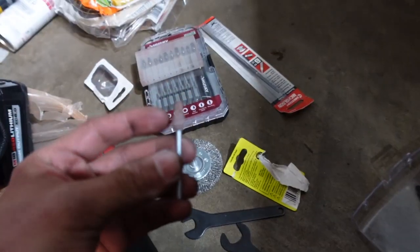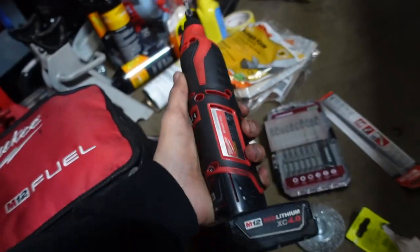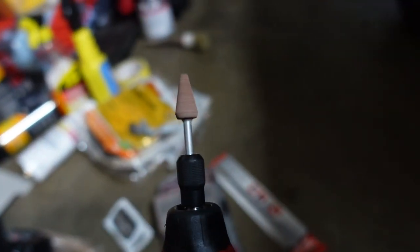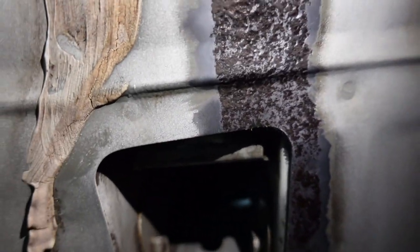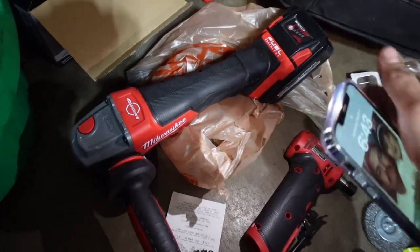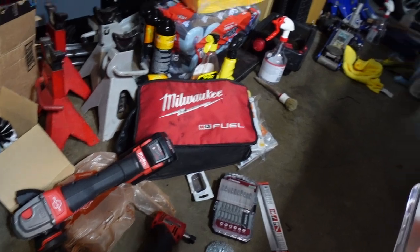These little sandpaper cones aren't a quarter-inch drive so they won't fit the die grinder I have. I do have a dremel though. I wiped off the Rust-Oleum remover already — this area is clean bare metal, but all this is still rusted. I'm gonna try and use the dremel to get the area inside the corners, and for all the flat areas I'm gonna use the big wire wheel with an aggressive attachment. That's the plan because the rust isn't 100% removed yet.